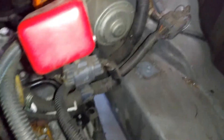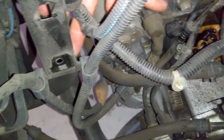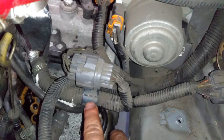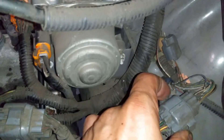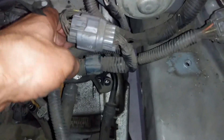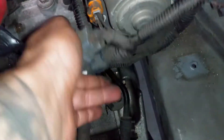Once we get off that battery tray, it should just come right up — but actually it won't come right up. You have this little connector right here, this little bracket right here, it's being held on by a 10 millimeter. Then you'll have this clip right here, and then you'll have three little connectors — one right here, that one, and then that one. For these, you'd go from the back, push down, and then this should slide out. Same thing for the others — just push down and it'll slide out.